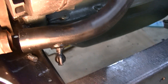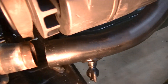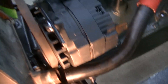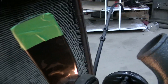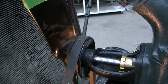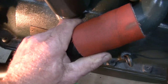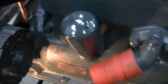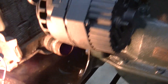With a B43 belt — we'll get into that more later — I've got clearance for the water hose, everything's good there. You'll see a little bit of green tape on the fan; that's just so when I'm running this you can see the fan. These things are deadly if they're invisible when turning.